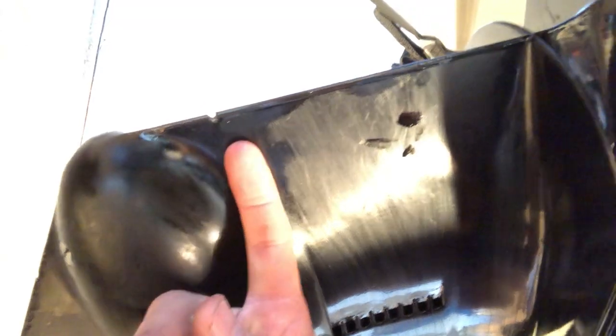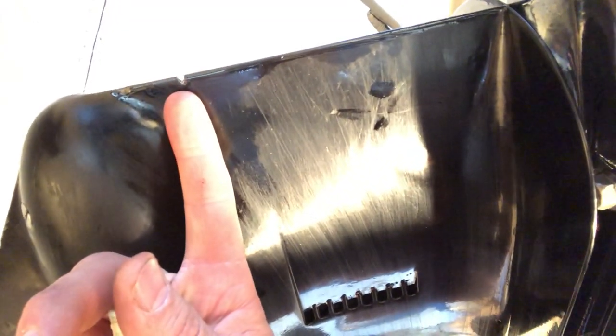The infeed hole I was talking about is down here on the leading edge of your outdrive. It looks like there's a nick right there in the front — that's actually where the hole is. You can see it right there.